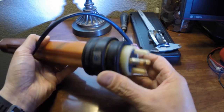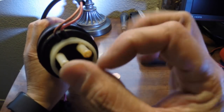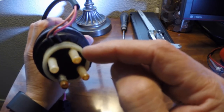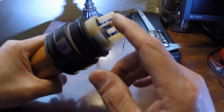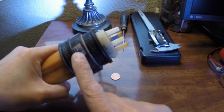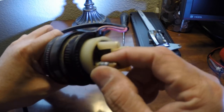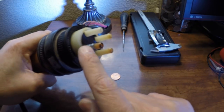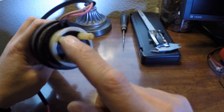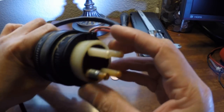Before I pulled this sending unit out, you need to identify the hoses. When I was pulling the black hoses out, I tagged them with masking tape — number one, number two, number three, and number four. On the rubber part, I also put duct tape to identify how to line this back up. This is my number three, so when putting my hose back, I know it's going back correctly. You just need to identify at least one. Some people use north, east, south, and west — it's up to you how you tag them, as long as you put your hoses back correctly.